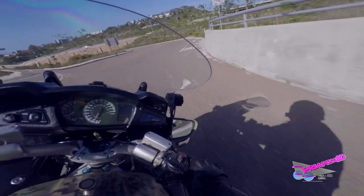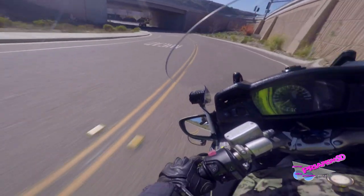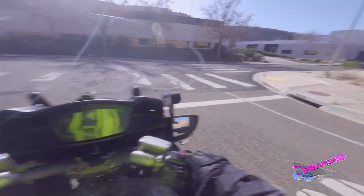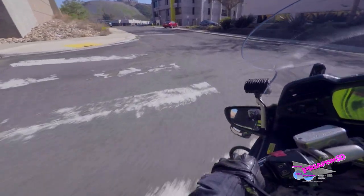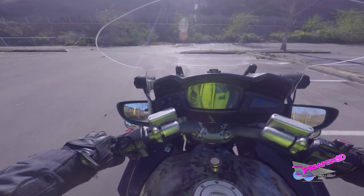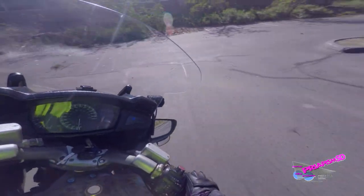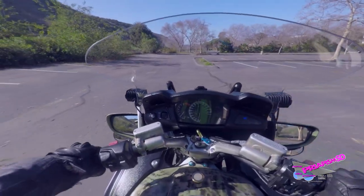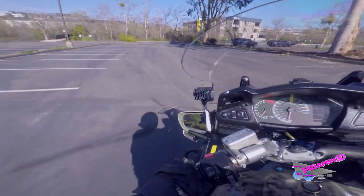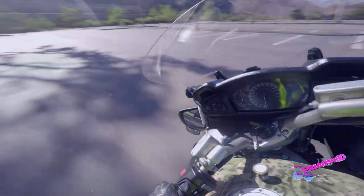The cornering is pretty good. If you're coming from a sport bike, you need to make sure you set up your speed ahead of time. You don't want to be chopping the throttle in mid-corner and then getting back on it like you would on a small bike. You want to set your speed going in and maintain at least a slight throttle throughout the corner, because the shaft drive effect will otherwise definitely buck the whole bike up and down.